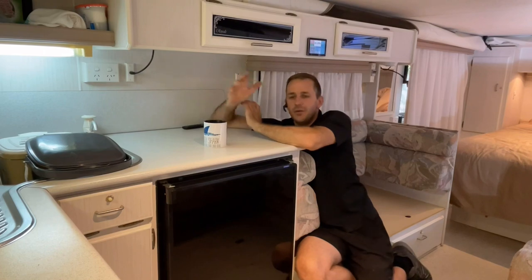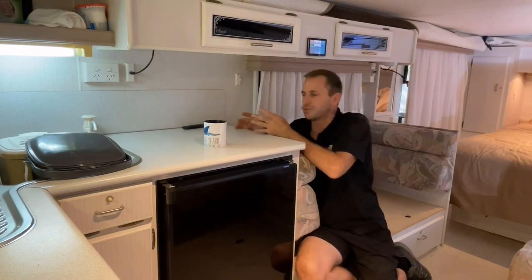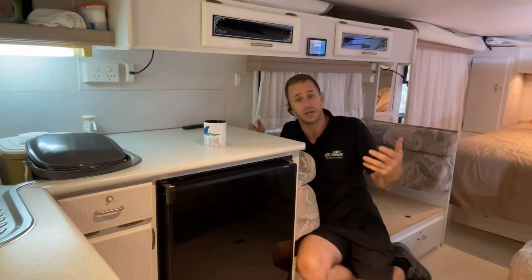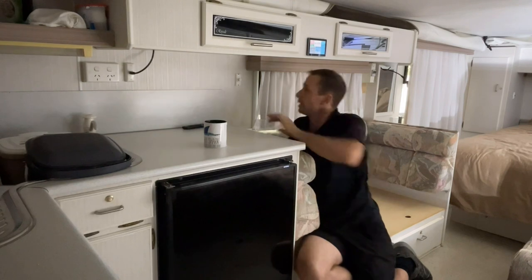So we've rewired it so it's only one power source now. It is only 12-volt lithium batteries. So when he leaves this switch in this position, it's a master switch for on. That's all of his 12-volt circuits that were existing. And then when he turns it off, that's off. That's his master switch completely off.